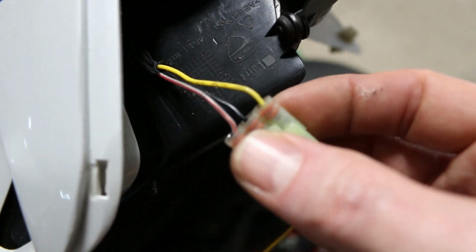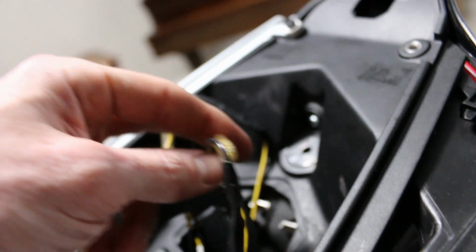If you use the actual blue connector, that'll go into the one with the red and white lead, if it's correct. Again, I have to test it by actually cutting into that wire and splicing it before I can prove it, but I do know that pulling on the brake handle does illuminate it. It just blinks. I don't know why it doesn't stay illuminated, but maybe it's just because it needs to be connected. Up here, pretty easy to access.